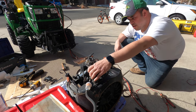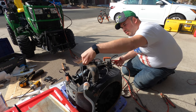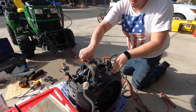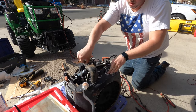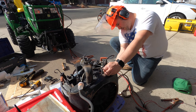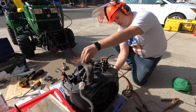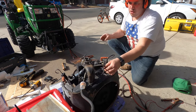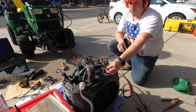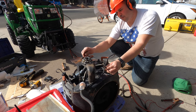Aside from that, put fuel to the carburetor and it should pop off. Now remember, I don't have the muffler on this thing, so I put on some ear protection. The reason why this thing won't stay running is because the throttle cable's not on it. Turns out it just didn't have enough throttle — I'm going to make some minor carb adjustments to get it smoothed out and running good.